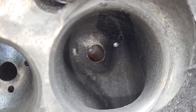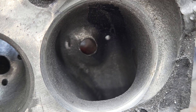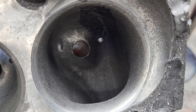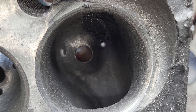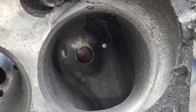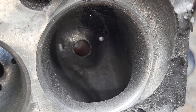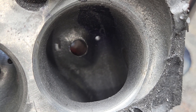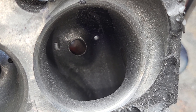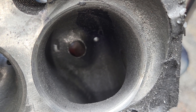We've got the carb spacers that Brian made up for us. I'll probably bring my modified BBD just to show what I did for testing. I do have some 318 valves that came out of these heads that Tim donated — I'll grind those for the right angle and bring them. I also have a set of brand-new 318 valves I'm going to donate to the project. The sizes I wound up using on the open chamber heads with stock valve sizes are 1.78 intakes and 1.5 exhausts.